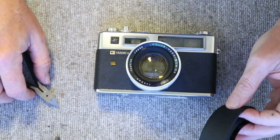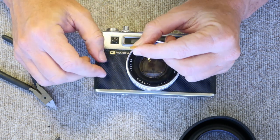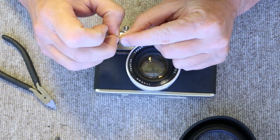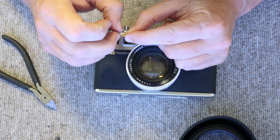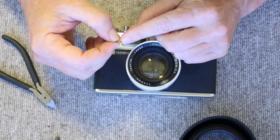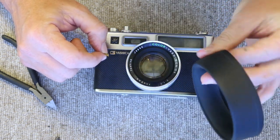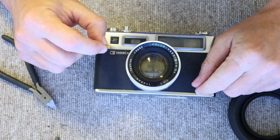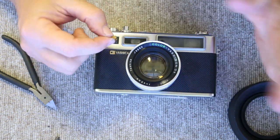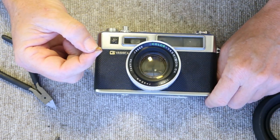You can also use leather. For example, if you have an old leather watch strap or camera strap or something which is about 2mm thick, you can cut that into shape and simply use a piece of leather. As long as it's roughly the same size — and you can be as much as half a millimeter off in one direction or the other — the camera will still work properly. It just has to be in the ballpark. It's about 2mm thick by about 5mm long by about 3mm deep. Luckily I still have a few of these original Yashica ones left, and this urethane is still in nice shape — supple and smooth. It doesn't crack or anything, so once I put this in, the camera should be good for a number of years more.